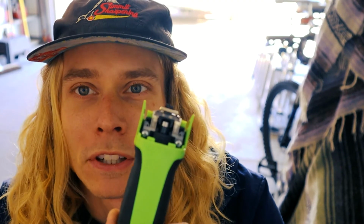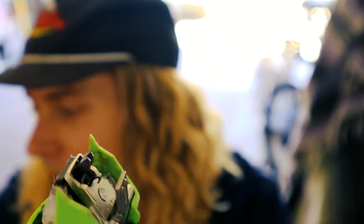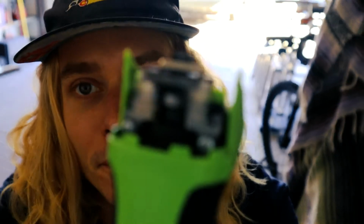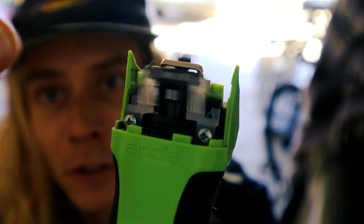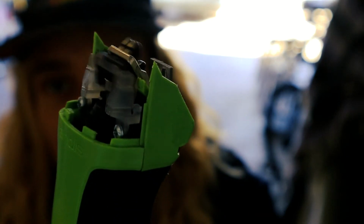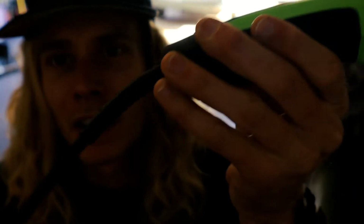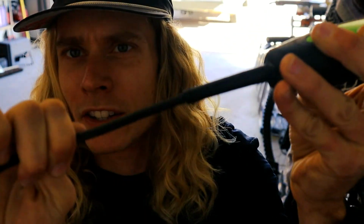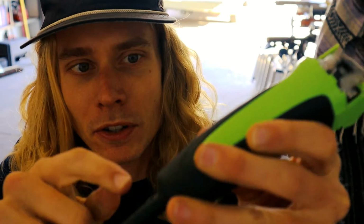All right, back with these clippers that needed the new front motor mount. And just wanted to show you that they sound much better now. Well, if you can hear it, it's all good. Cam's running nicely. All the speeds work. And that's how I test the cord. I just kind of pull on it straight back and wiggle it around. It's not cutting out, so the cord's good.